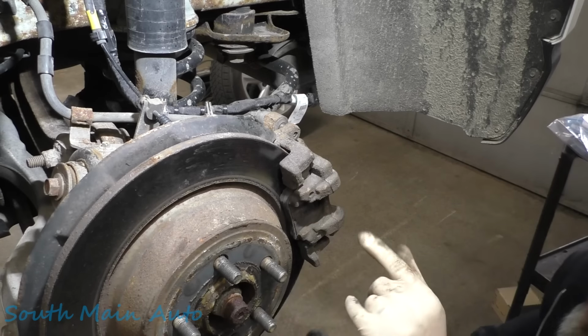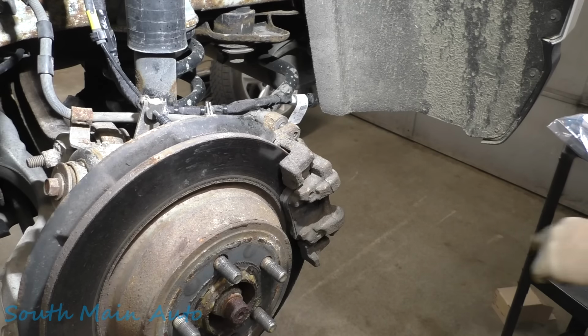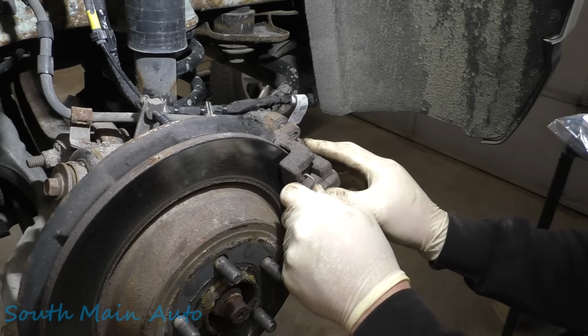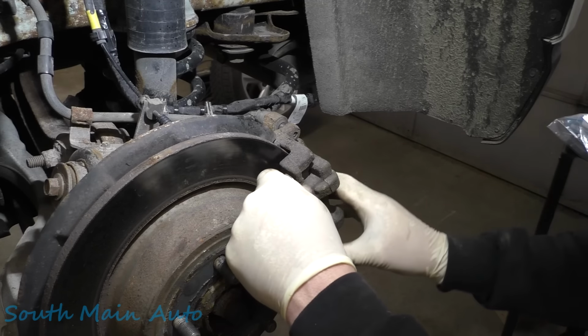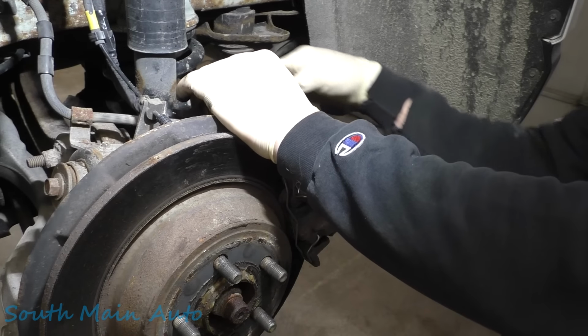You have to be careful with this style pin on these. The ones they use, like they use the same one on Dakota, I think it's like a 9mm thread. You don't want to go frigging them up. Chances are nobody around you has a 9mm helicoil. So there's that. We'll finish clicking this thing in all the way.